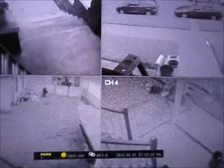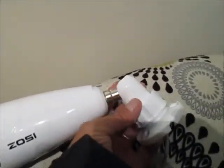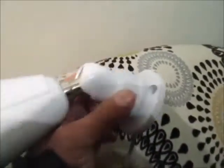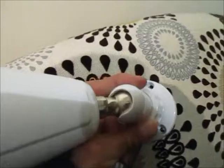These are my Zmodos and I'm going to put a Zosie in. You can see a car but you can barely see it. The Zmodos, right where my thumb is, have a butterfly to move the camera up and down. Well, these Zosies have a bigger mount right there, and this right here — after you screw it on — is what you tighten up to stop the mount from moving. I'm going to screw those three screws in and put it up. Okay, here's the Zosie camera.